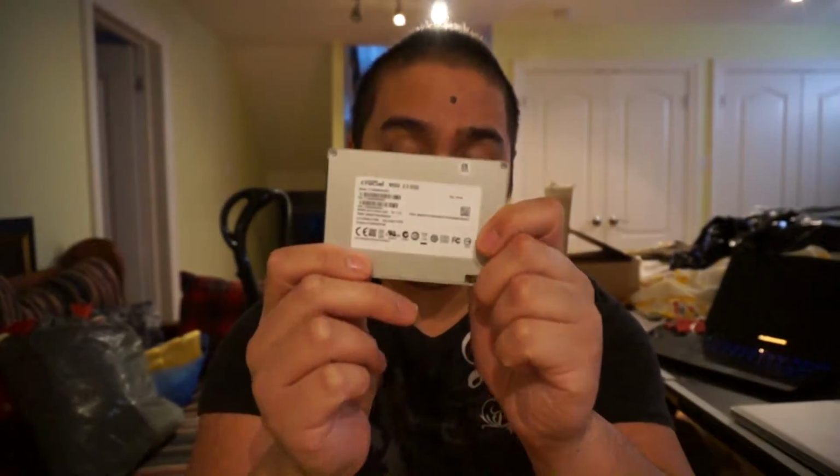The thing about MacBook Pros is they use a 5400 RPM drive, which is the slowest drive you can put in a laptop, and we're replacing it with an SSD, which is significantly faster. I find it really shocking that Apple would put a 5400 RPM drive in a MacBook, but other providers are doing that right now as well. I find it quite ridiculous, as that's the slowest drive you can put into a laptop. And come on, people are taking these on the go. They need to be quick. They're going to open and shut the lid as they go.